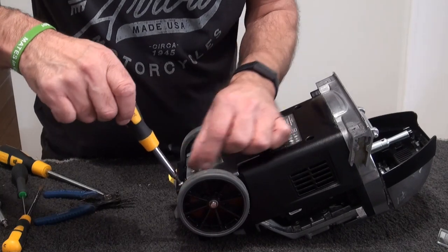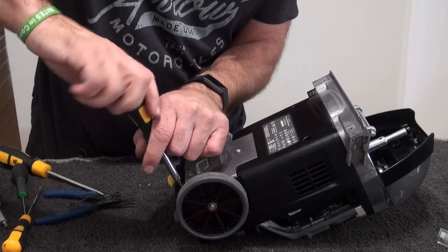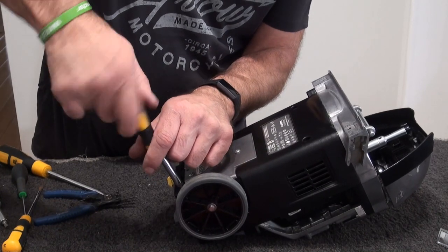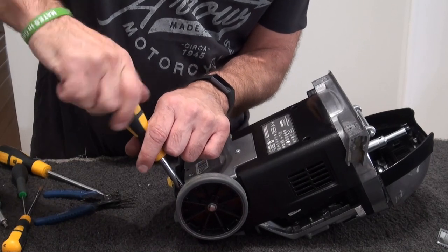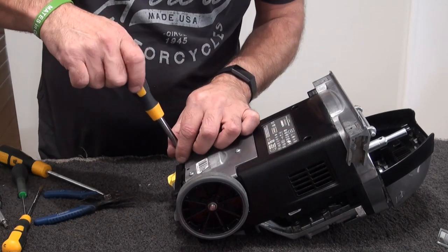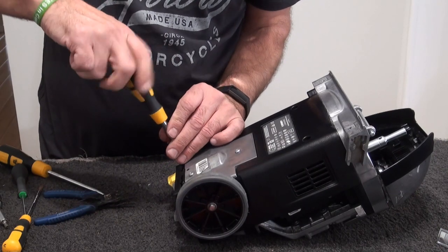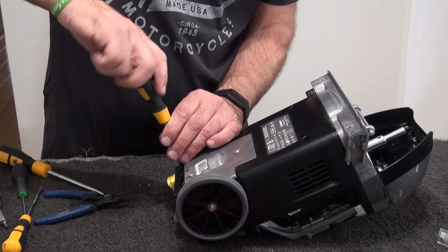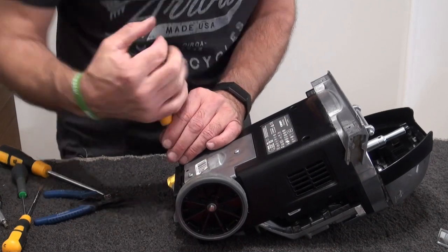See, by the bottom of this, it didn't have to clean it really, it was spotless. I mean, it had it slide apart with a bit of dust. I mean, it's never actually been used, definitely never been used for shampooing. If you want to shampoo them, I tend to turn it upside down and drain it, make sure it's all dry so it doesn't corrode. So if you ever buy a Kirby and it's all corroded along here, it's because people have either stored it in a garage or in a shed, or they've shampooed with it and left it and not dried it off.